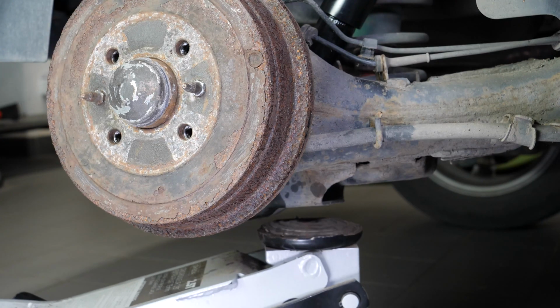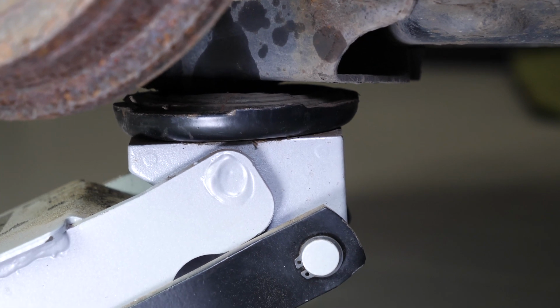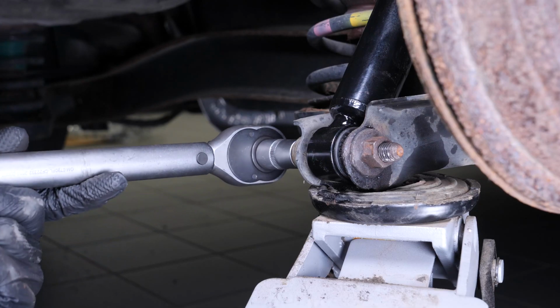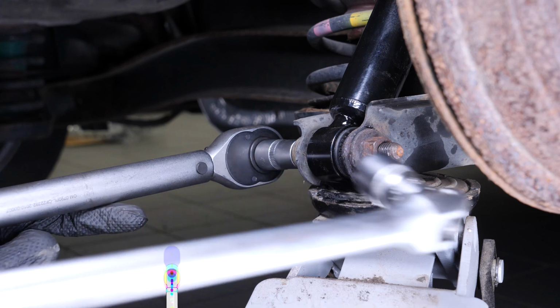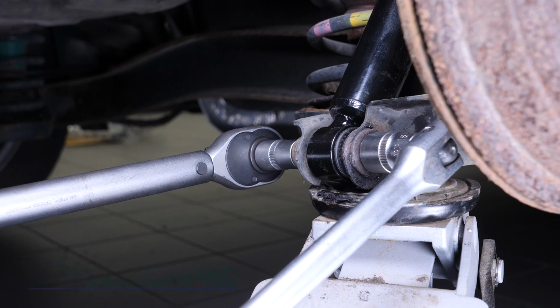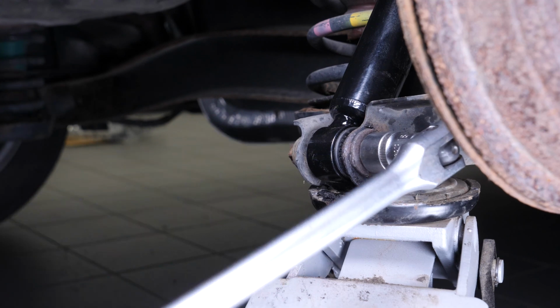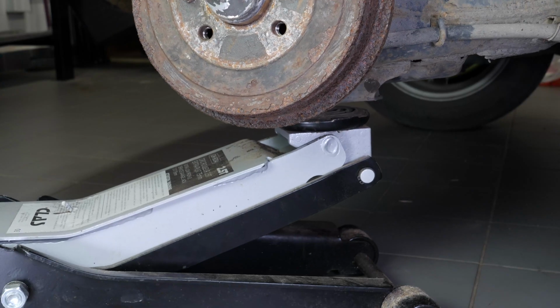To avoid damaging the silent blocks, final tightening of the lower shock absorber retaining bolt must be carried out with the rear axle in the vehicle on the ground position. Lift the rear axle with a jack. Once under pressure, finish tightening the screw with a Torx wrench. Remove the jack.